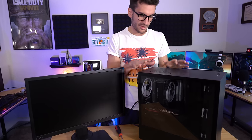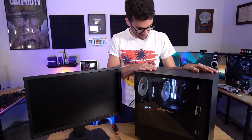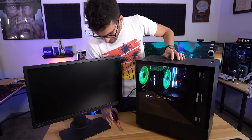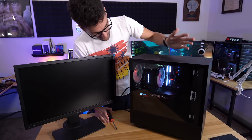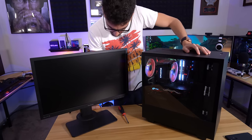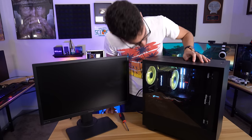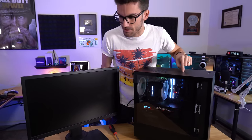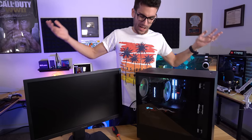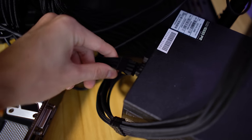Just to recap, this is what happens when you turn on the PC before we take it to the Geek Squad. It looks like it turns on, all the lights are lighting up, the fans are spinning, hard drive spinning, we can see we're plugged into the monitor — but nothing. No POST. The DR debug disappeared as well, so there's literally no indication that anything is wrong at all. And the only thing we've done is unplug the supplemental 8-pin power connector on the power supply side. That's all. Let's take it there and see if they can figure out what we did.